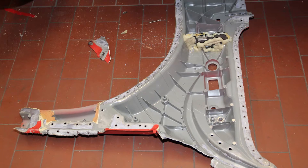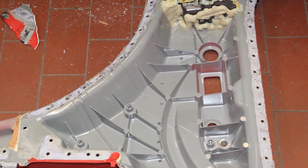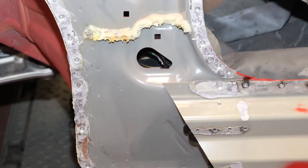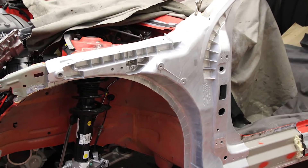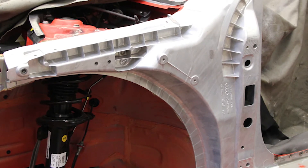In the picture you can see how the holes that result when the rivets are removed from the disassembled cast aluminum part are not damaged around their edges. This is also the case for the inner part of the A-pillar. Using the system we have developed to meet these challenges, you will see in the following video how easy and reliable the replacement process can be for such components.